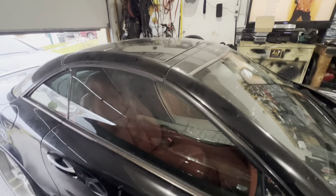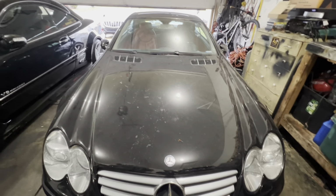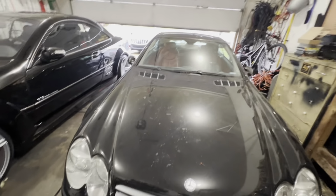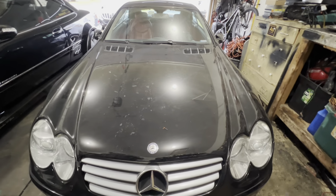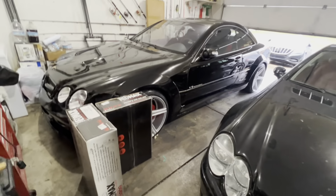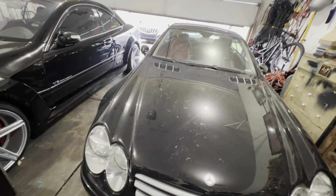They're lightweight. When you remove all the ABC suspension, you shave about 300 pounds, maybe a little bit more when you remove all the lines, all the valve blocks, the struts, the pump. I replaced the ABC tandem two-part pump, which operates the suspension as well as power steering. I removed that, and in its place I put a standard power steering pump. So that shaves a lot of weight, simplifies the system, and focuses on the rack and pinion instead of the suspension as well. So that over-engineered pump that serves its purpose when you have ABC is removed.